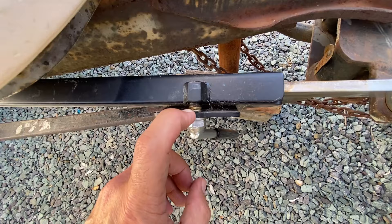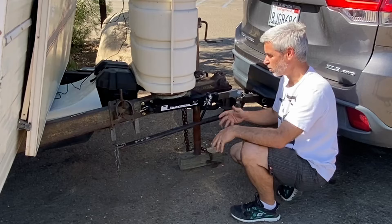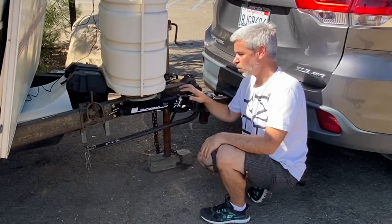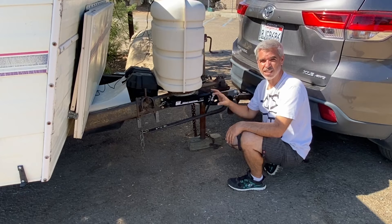Part of the process is going to some tightness level — it's going to sound horrific as you turn, just moaning and groaning because this whole blade is sliding in and out. So until this breaks in a bit, this is kind of a loud setup. But what you'll see when you go down the freeway is when you dodge a little bit left, a little bit right at freeway speeds, you'll see in the rear view mirror and feel the whole thing kind of fishtailing or swinging you around. When you go a couple turns tighter, you'll find the trailer pretty much just follows you nicely. At that point I found on city streets it was really noisy and tight, so when I pull off the freeway I'll go ahead and loosen it back up again.